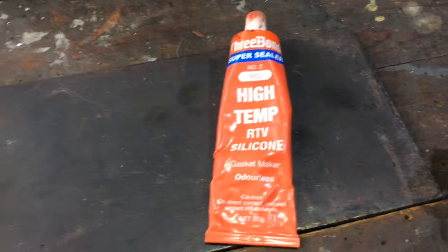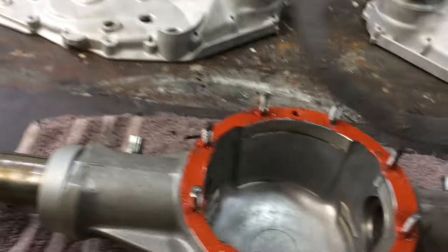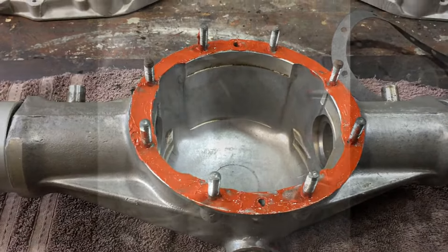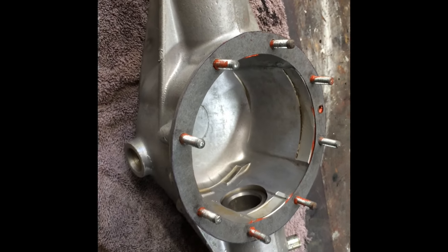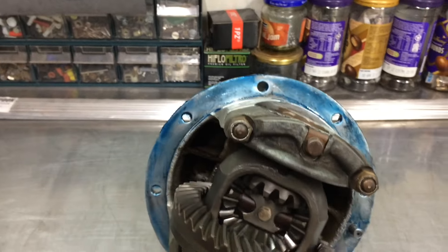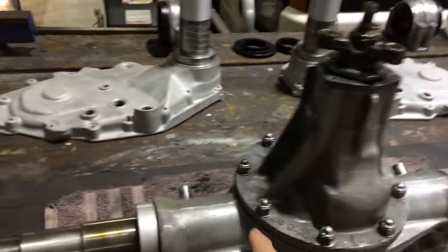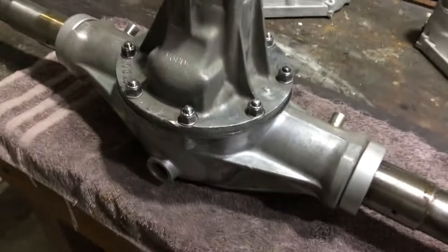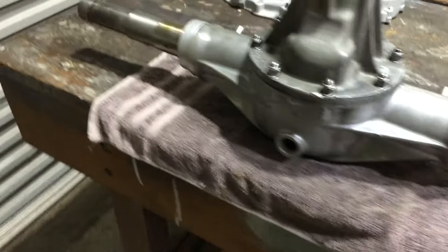That's done. I'm going to put a bit of that stuff around there, put the gasket on top, and just put a little bit of grease on the other surface. I'm not putting it on both sides in case you want to pull it apart - it's a lot easier when it's not totally glued. There's our gasket made - takes longer than you think to make stuff like that. I've loaded the surface up with grease and glued the gasket on the other side.